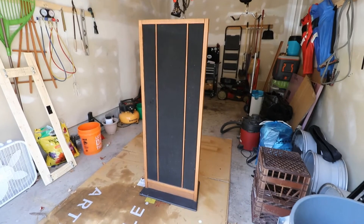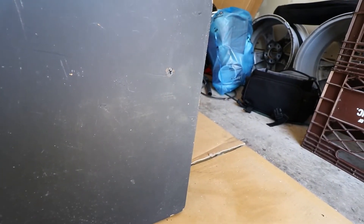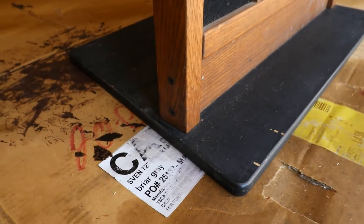One thing that's great about these speakers is that they're not very heavy, which means it's very easy to move them around, as you'll need to do plenty of when you work on them. The first step to disassembling the speaker is to take off the stand. You have three large Phillips head screws at the base — remove them. Next, take out a few more Phillips head screws: two down here, one on the middle side, one up top, one in the middle up top, and the other side is the same with four screws total on that piece.